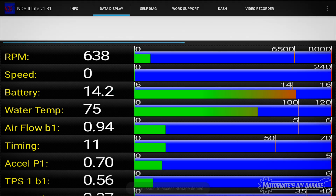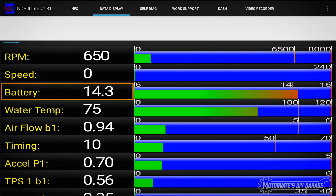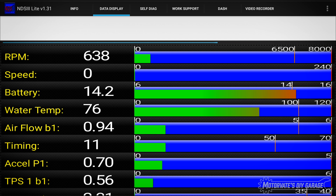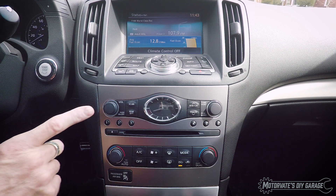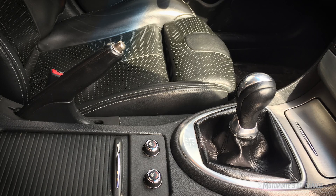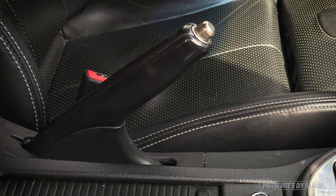Touch the data display tab. In order for this to work there's a small list of requirements or preconditions that must be met. The coolant temperature must be between 70 to 105 Celsius (158 to 221 Fahrenheit), and the battery voltage must be greater than 12.9 volts. As we can see here they are in the required range. Excellent. Also the electrical load needs to be reduced as much as possible, so turn off the climate control, turn off the radio, and if you have navigation turn off the nav screen. If you have daytime running lights make sure the parking brake is on before you start the car — this will prevent the daytime running lights from turning on.